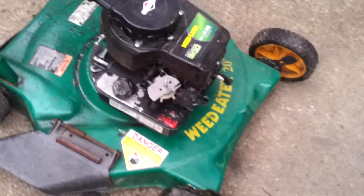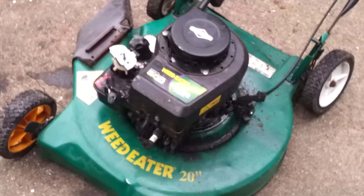When I found this mower, I had to do a little work to it to get it running. It smoked like a freight train, so I tore it apart and found out that the cylinder walls were real scored up. Everything else inside the engine looks pretty good, but it's really not worth the trouble trying to save that.